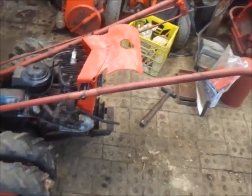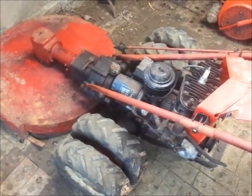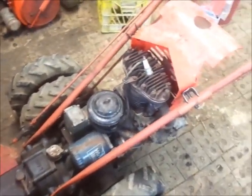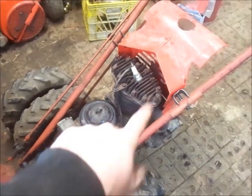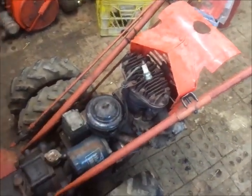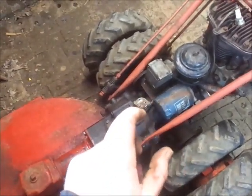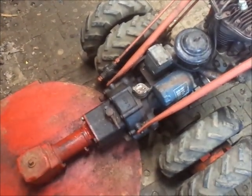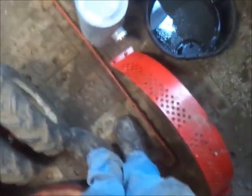Alrighty guys, before the radio goes off the commercial here, I got a wild hair this morning and decided to start putting this 53L together. So I've got it most of the way put together here, as you can see. Now I'm to the point where I'm missing parts. I'm missing the top air deflector on top of the cylinder. I am missing the shift lever, shipper shaft, and the loop for the handle to go through for the PTO shift lever.